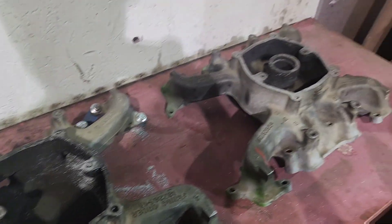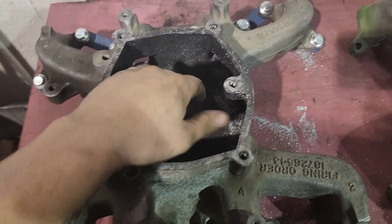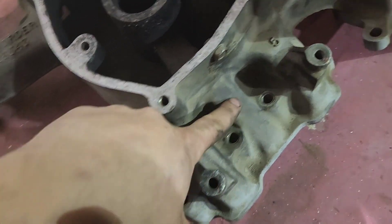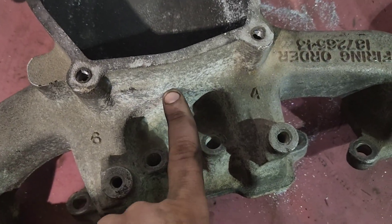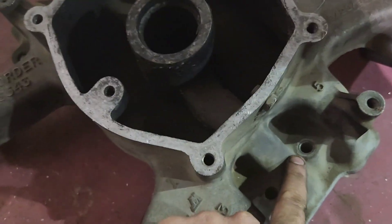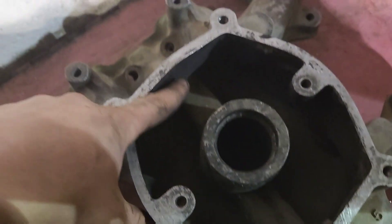And as you can see, a huge difference. F-Vin — free-flowing, no EGR port. But you can see in here, through the center — that's your EGR. Not right here, all open. And then here's your EGR port, which runs in under that channel I showed you on the bottom. That comes through inside here, both sides.